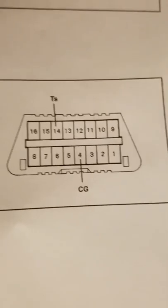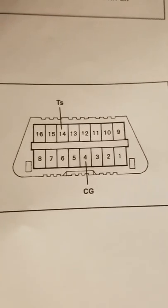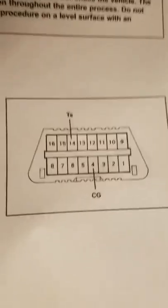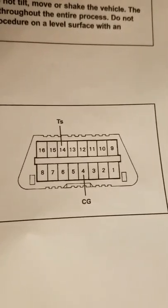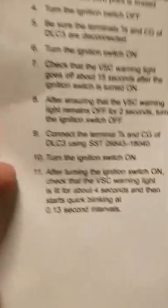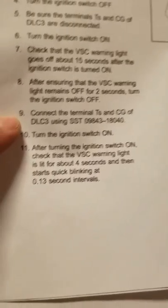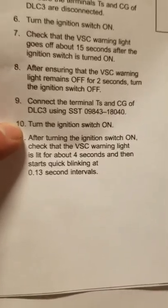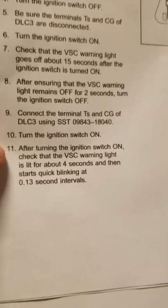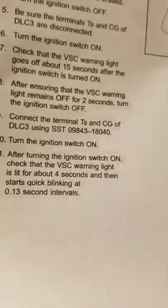So you plug them in — your copper wire or paper clip — with the ignition on, tap them together four times within eight seconds, and on your dash the check engine and ABS lights come on. My ABS light came on solid but it was not on before, so I thought I screwed something up. But then the track control started flashing and coming on — because remember, that's usually off until you move the car. The first time I did it I forgot to do the final steps. You have to turn the car back off again, and then step nine is where I had to screw my two copper wires together so they're one piece, turn it on with it plugged in, and after I turned it on my lights started blinking like crazy immediately.